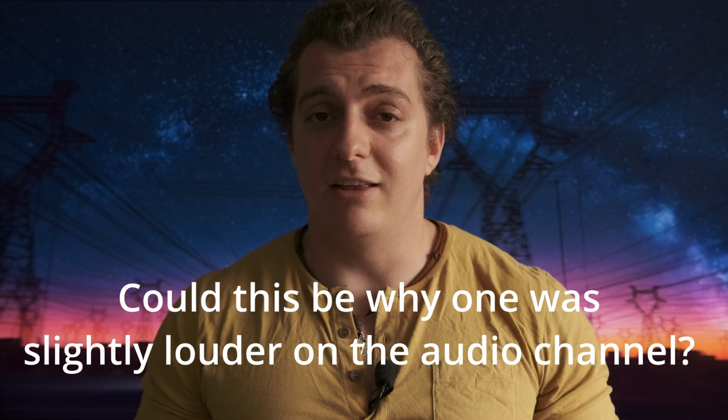Okay, so as you've seen, there's no differences in terms of the mic capsule, the foamy bit, the clip, or the sound. They're identical in all ways. The only difference is the end connector. One is TRS, the other one is TRRS. The TRS is made for cameras, Lavalier Go 2, I forgot which one is which. And the TRRS carries the microphone and the headphones, and is made for smartphones and stuff. So it needs to work with that. But if you have one, just buy an adapter and you can use it in most situations. Whichever you have, it doesn't matter if you've got a SmartLav or the other one, just buy the adapter that you need.